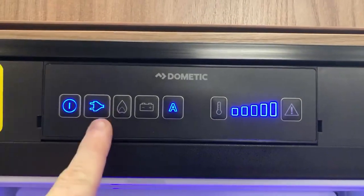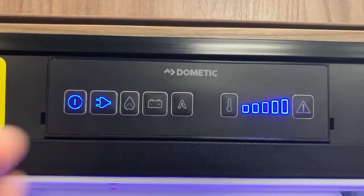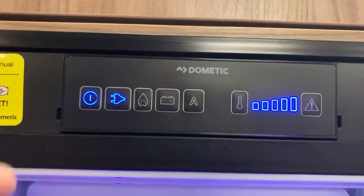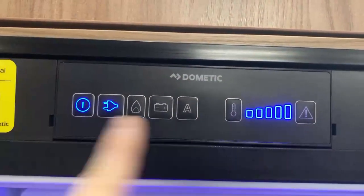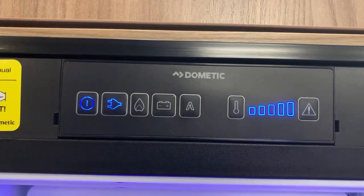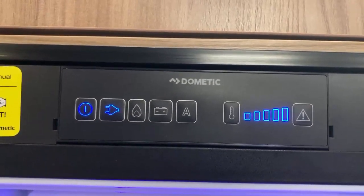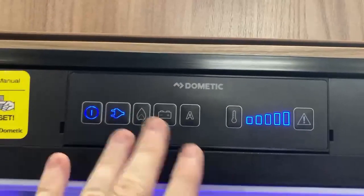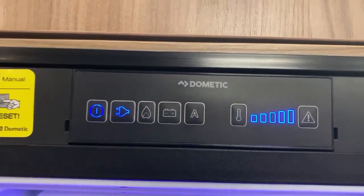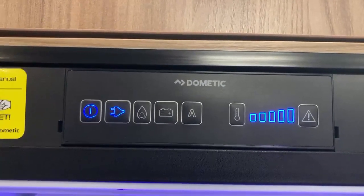To choose the energy selection, you press these buttons. Now, this panel does have an inactivity timer — after a brief period of inactivity it's going to dim the lights slightly. There you go, they've just dimmed very slightly. When the lights have dimmed, the first press you do on the control panel, regardless of which button, is just going to bring the panel back to life. This dimming is so the lights are less intrusive at night when the motorhome is darker overall.